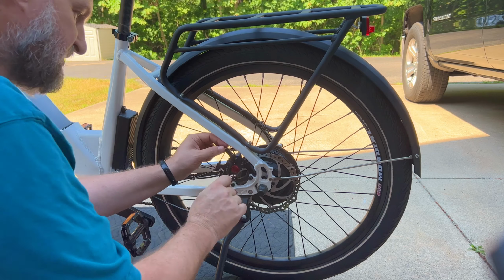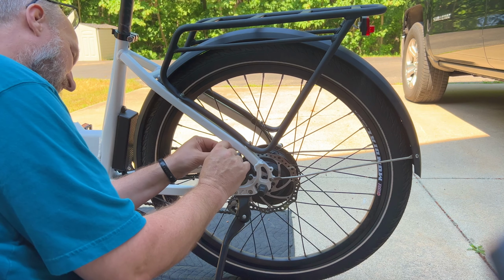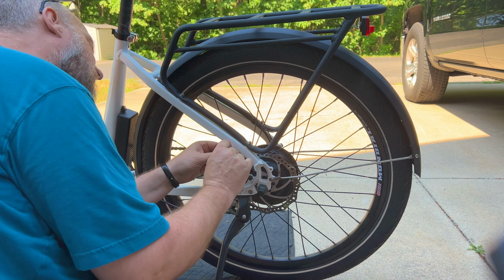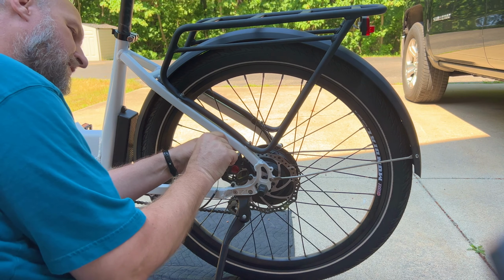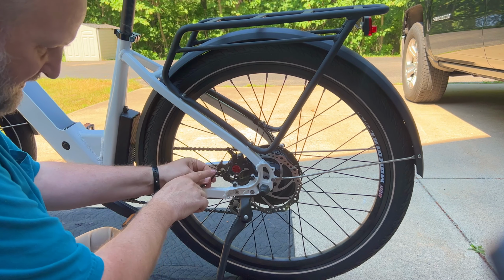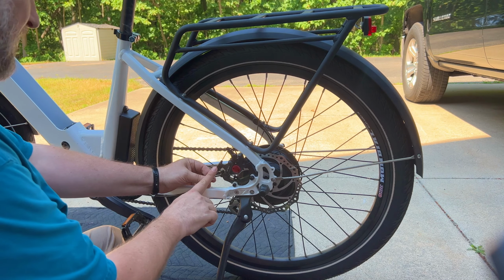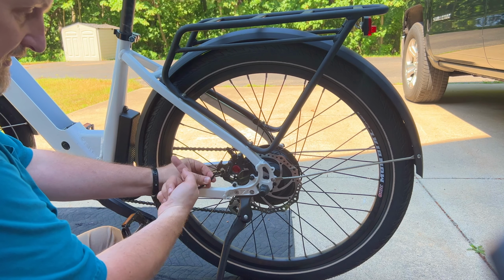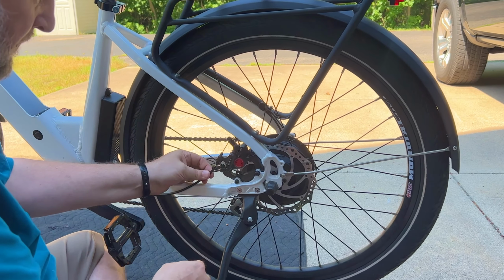Okay, then we've loosened up the crimp bolt here. We're going to lift up the little bracket and slide this underneath. Sliding the cable up underneath the crimp bolt. Again, we make sure that the silver part goes all the way up in the barrel connector, and we check that both down here and up above at the brake handle, which up above looks good.